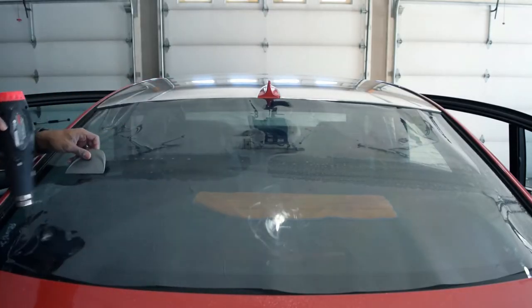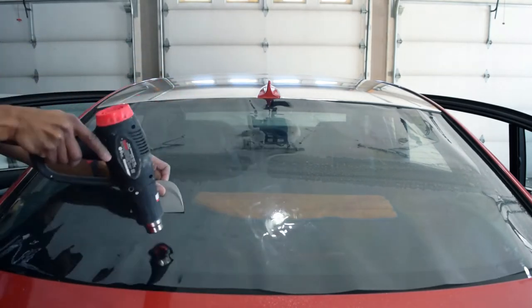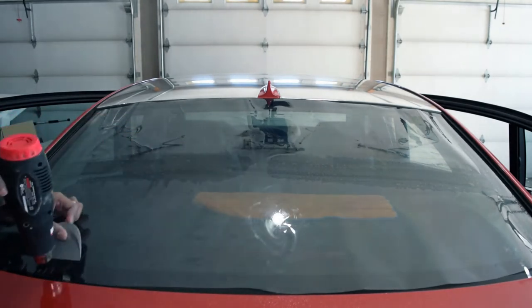I lied — I stripped this back window off and there was still a bunch of glue. So it's been about 20 minutes: I steel-wooled the whole back glass, cleaned it off, and now you can see I've got the film on there, all trimmed out, H-pattern down. Now I'm going to shrink it, install it, and we'll be good to go.